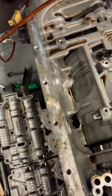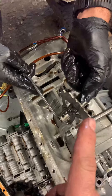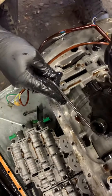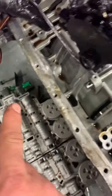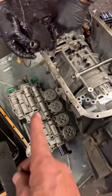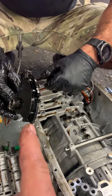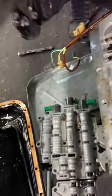This thing sits in here — there's a spacer on there and there's this little metal mechanical selector as well. It sits on here like that, and then these two grooves line up to the metal spring plate. There's a metal spring plate that's the valve body, so you will have to get the valve body out to get this out. The goal is to fix the gear selector problem — the transmission thinks it's in the wrong gear. This is the sensor; as you can see, it slides on that metal plate.